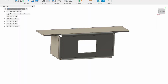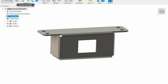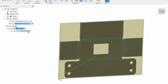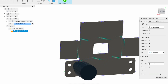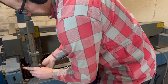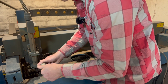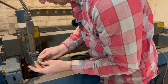I'm not going to show a full design how-to — that's a whole career in itself — so I've run through a quick animation and we get through to a flat pattern. The beauty of Fusion 360 is we can take that flat pattern, move into the manufacturing tab, and generate the G-code required for the CNC plasma cutter. We can even watch a simulation of the toolpath to see exactly what the cutting head will do. Now that we've done the CAD and spat out the G-code, I need to set the plasma cutter up for the specific material — 2mm aluminium. We've got 80-amp consumables in here which would be excessive for 2mm, so I'm dropping down to 40-amp consumables: 40-amp shield cap and nozzle.